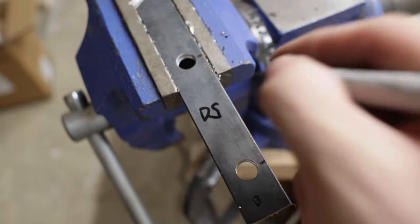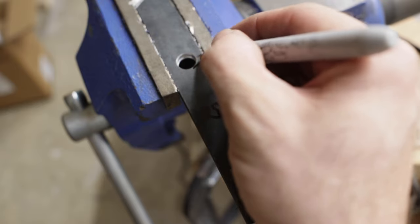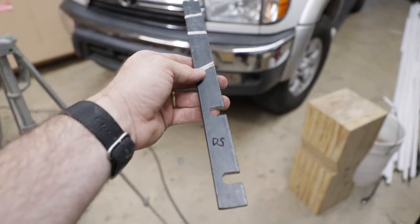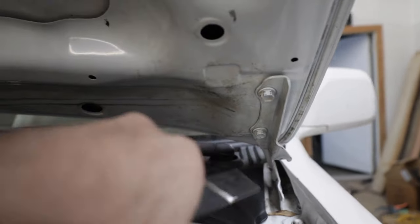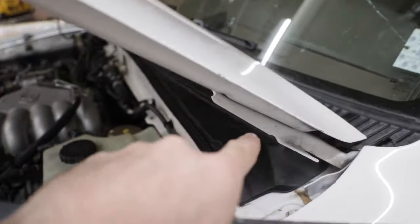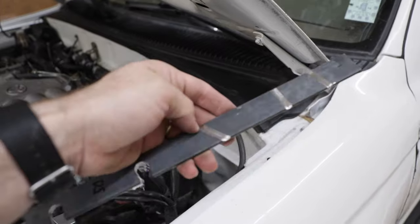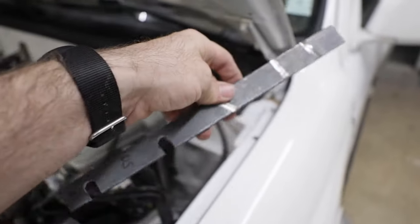We're working on the driver side bracket, so we need to cut out the right side of these holes here — and then that'll look just like that. This is our bracket so far, no bends yet. This bracket is going to mount right under here under these two 12 millimeter bolts. But to get it in place, we first need to bend on our first two marks so that we can clear the cowl and the windshield, then test fit it and figure out where the rest of the bends need to be. That's why it's really good to start with a thin piece of steel first — you can't really mess this up.